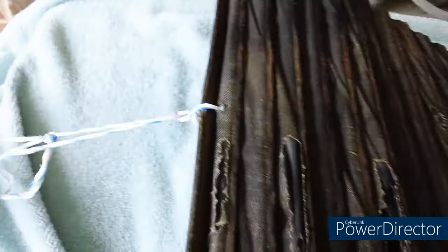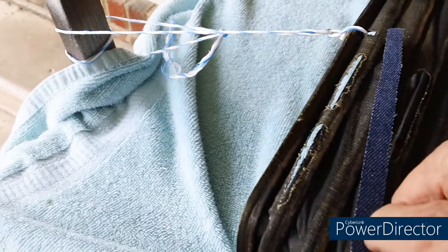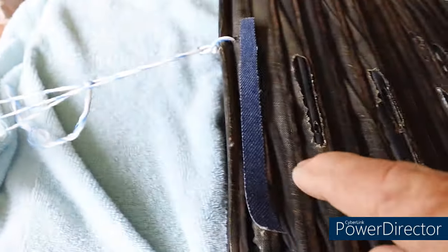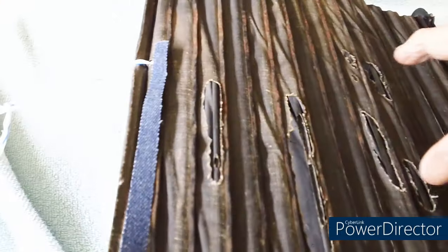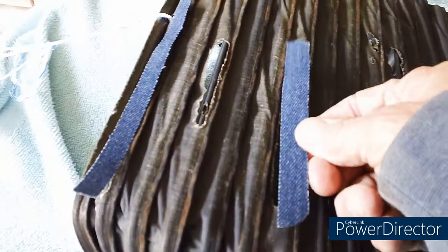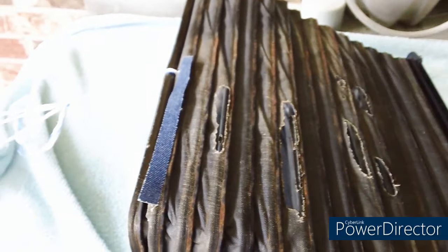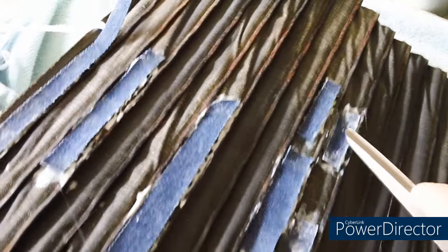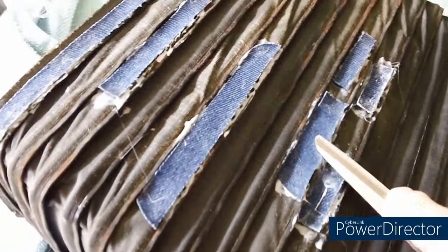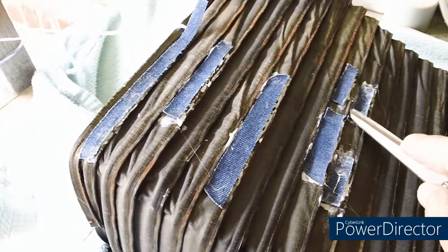There we go. There was a hole in the fabric right here - I went ahead and used it, and I'll patch that last. You have to put cement on both pieces of fabric - the underside of this and the top of this part - then press it down. I'll lay in a couple more all the way down until I run out of fabric. Now that I stretched it out, it may not be quite wide enough. I'm glad I bought plenty. This didn't quite dry 24 hours - you're supposed to let it dry 24 hours - but it's on there and you can see how secure it is. We've got our strips in. The glue's not dry enough to hold them all the way down flat yet. This is only Stage 1. Stage 2 will come after everything is dry, probably tomorrow.